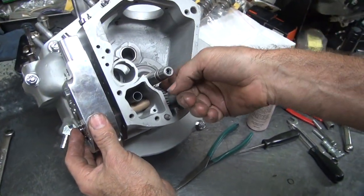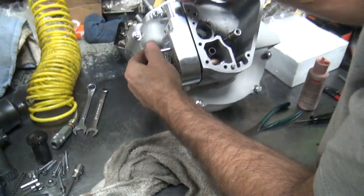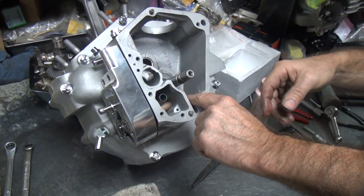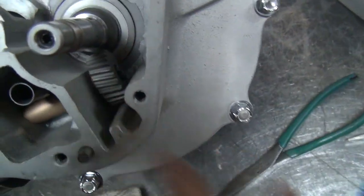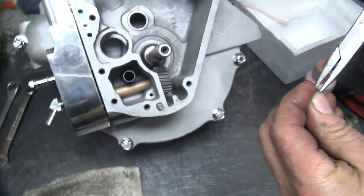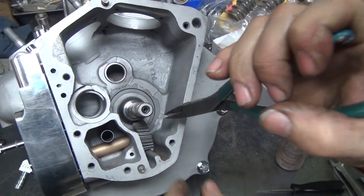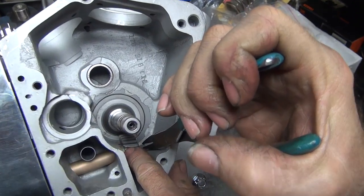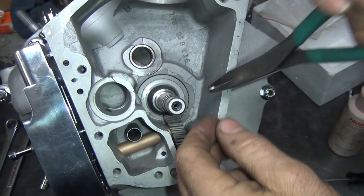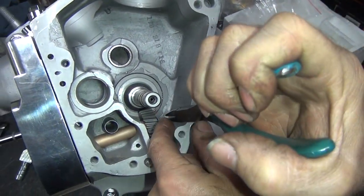That drops down. Just slide it a little bit. Then I'm going to throw a bolt over here just to keep it from falling off. So now you have to line up the keyway right there, then take these — key installation pliers. You've got to kind of fish this through that hole right there in the dark, because you have no light. And the pump just slid out because it doesn't want to go in that groove.